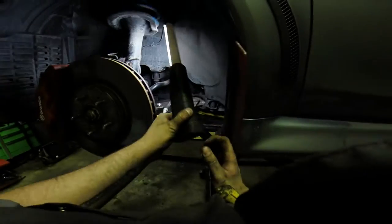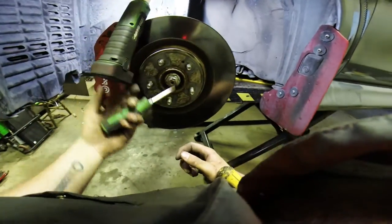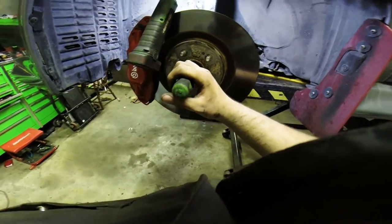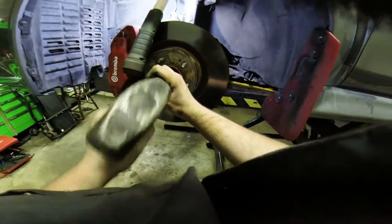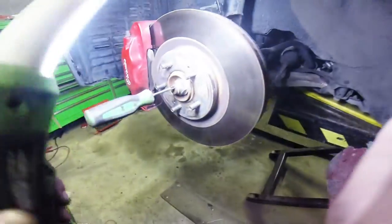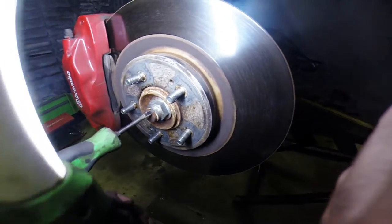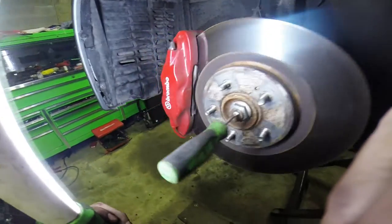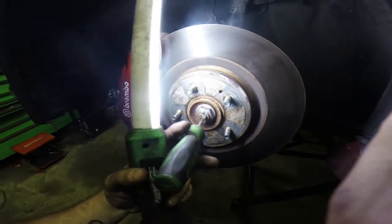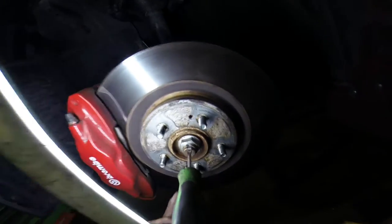I don't have replacements and I'm not waiting to get them because there is a trick to do it. Put a screwdriver right in there and tap it in. As you can see it's going to lift it up a little bit — a little pry action — I'm going to lift that up so it doesn't mark the threads. We're going to take those off while everything's still attached and tap right here in the center where that center hole is with a punch or my air hammer to burp it in so it's nice and loose.